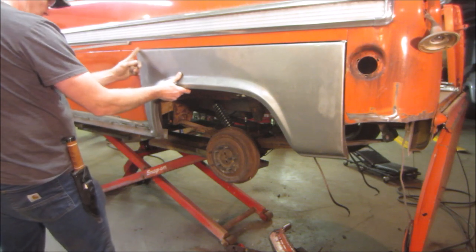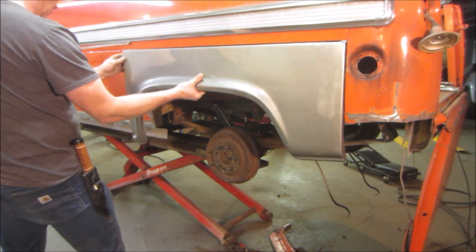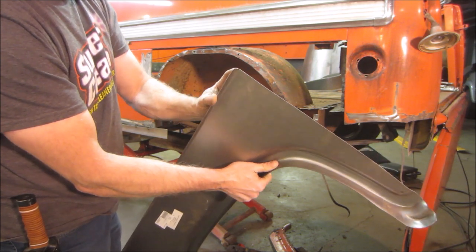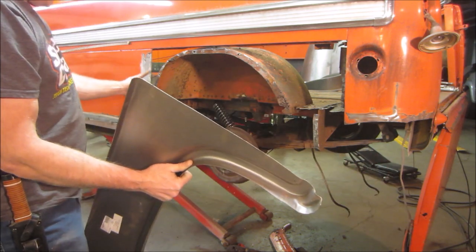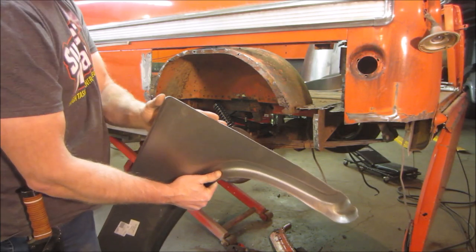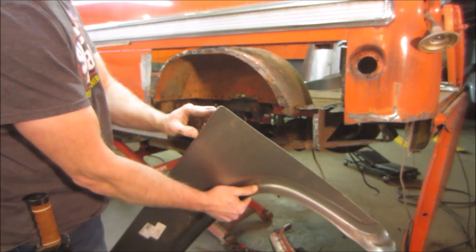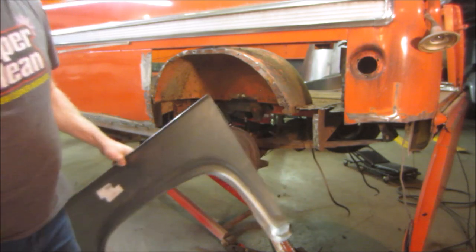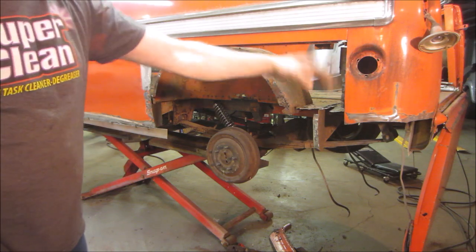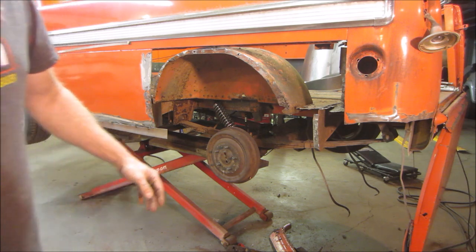I am going to go trim this fender back patch panel. I'm going to knock off that edge that they got on there. I'll cut us a clean edge, we'll start, and then we'll come back here, we'll cut this edge to match, and we'll flange it so this has some place to go, and we'll notch it, whatever is left of that corner. And you know what, you gotta speed this up a little bit. I'm gonna prep all this while you're not looking. We'll go over and get what's left of the welds off and knock off the crap.